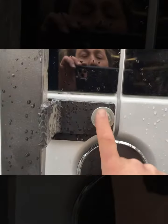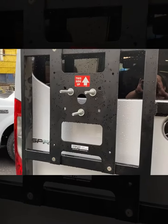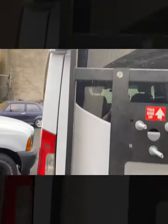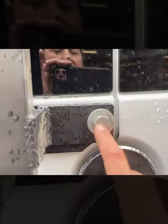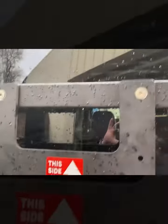First you're going to have to mount this onto your Sprinter — put that on with the hinges. On the right side here you'll have a hole, so you mark where your hole is. Then you'll take this back off to drill that hole. After you drill the hole you put this back on to make sure it lines up. These are human-made, not robotic, so our fabricator could be millimeters off. Put the plate on mounted so you can get a mark right on the nose, then take it back off, drill your hole, put it back on, and mount it. Sometimes these come already pre-mounted; sometimes they don't — if they don't, you just mount them yourself.